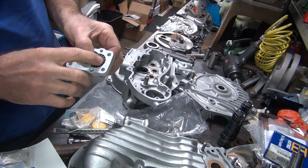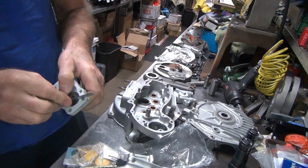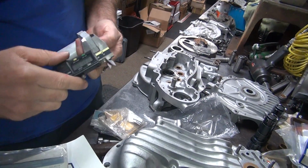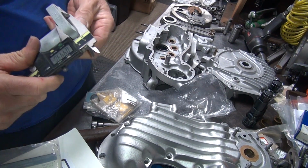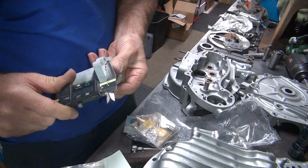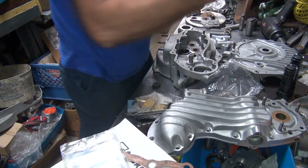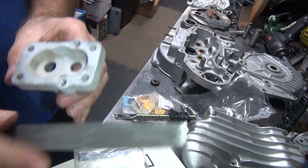So there's a certain amount of distance between those two surfaces. And right now it feels flush. Nope, just touching it, barely. Caliper. So if we go across the face here, 42, 41, 43. Let's see. The gear's spinning, so there's burrs on the surface right here. Don't really feel them, but you can see them and hear them. Probably from the CAD buildup.